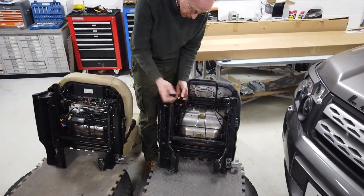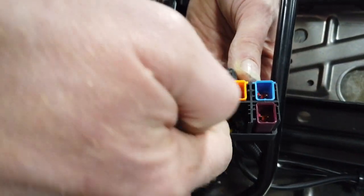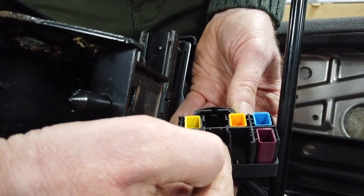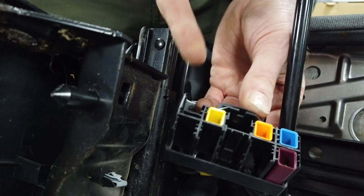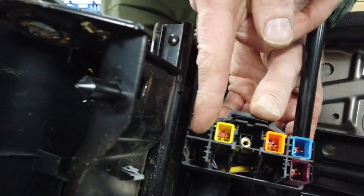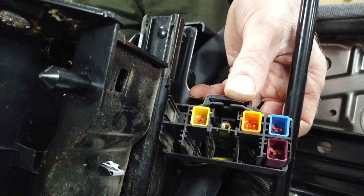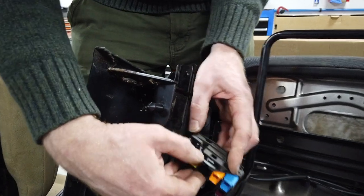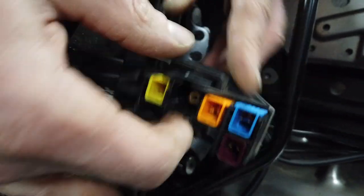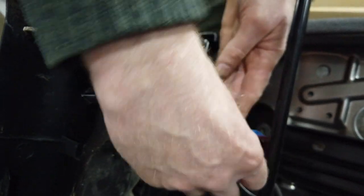This is my original manual seat again. Opposite the fixing bolt hole you can see that little brass nut - and you'll see this bit is not populated, nothing in here. That's where those two big fat wires went, so obviously they're there to give extra functionality. Also notice this heated seat wire position on the car - it's not present on the seat. So my car has got the capability to control more than the seat fitted in it, which is good news. There's a little tab there that folds down to undock those connectors, so that's how that works.